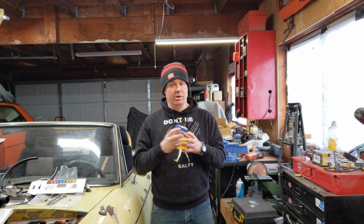I've been working on my house quite a bit, trying to get some stuff done, and that's been taking up all my time. So I haven't finished the brakes yet. The last thing I needed to do was pull the wheel cylinders off of the Datsun and figure out why they weren't expanding. It's because they were seized up and needed to be taken apart, cleaned up, and reassembled. So hopefully when I put those back on, they go on super easy and quick, and everything works as intended.